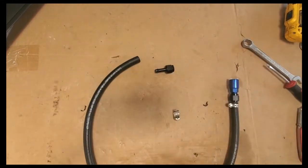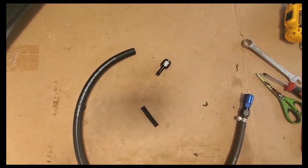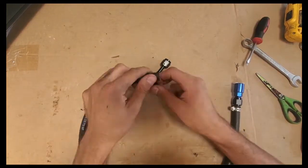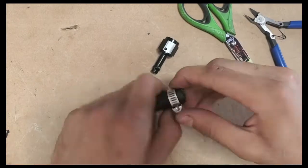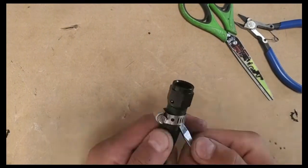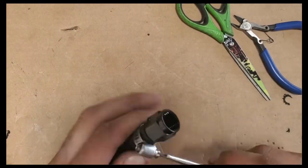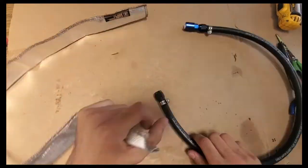On one end, you have to install and tighten a 5/16-to-AN quick connect fuel fitting. Install the version with the secondary retainer — you don't want high fuel pressure and vibrations disconnecting your unsecured fuel line and then spraying onto the hot exhaust. On the other end, you would have the other quick connect, but that is left on the motor. That kind is the regular one with the white plastic piece, as the fuel rail actually has a retaining ring for that version.